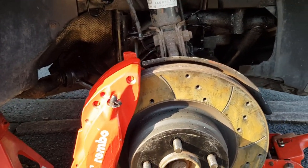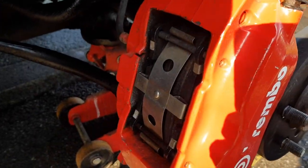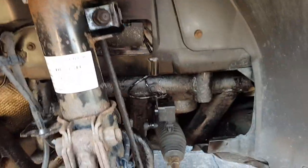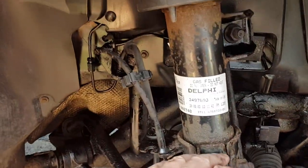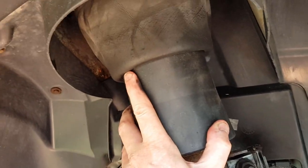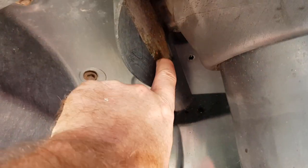Okay, that's washed off, looking a lot cleaner now. Brake pads are good. I didn't find out what the air leak was at this point because the air suspension level valve is in the discharge position. I did squeeze the bag and there was some water and air appearing from the bottom, so maybe a leak on the bottom with a seal. A little bit of corrosion there — I need to treat that. Cool, happy with that. I think we'll put the wheel on for today.